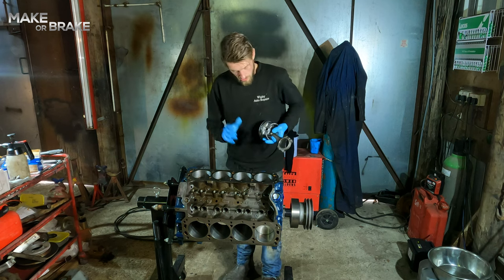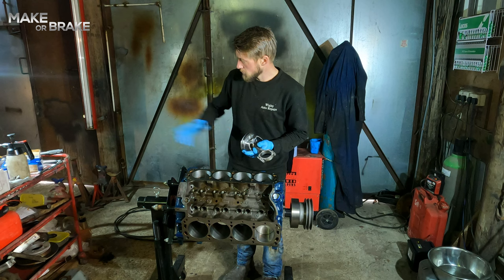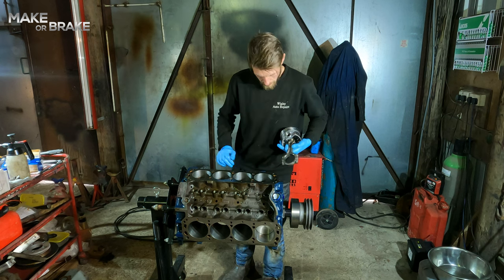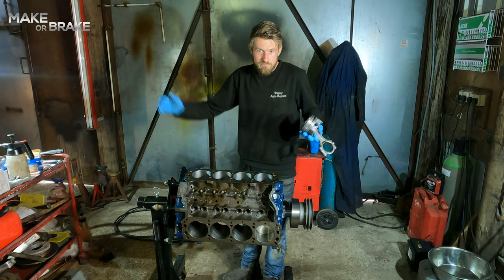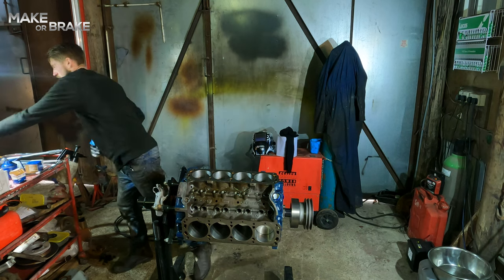So I'm going to oil this up, get the ring compressor set up, whip the cap off, offer it down to cylinder number 5, and get it bolted up. It's going to look exactly the same as the first one did, but you asked for these videos, we're going to keep giving them to you.